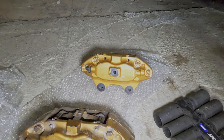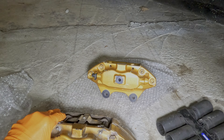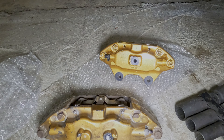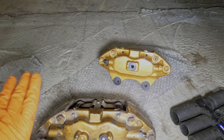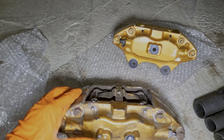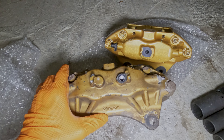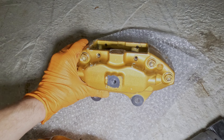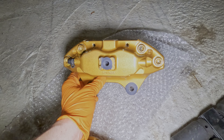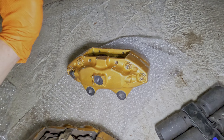So it's been a couple of days. I don't know who's a bigger bonehead — the guy on eBay that sent me the wrong caliper or myself for not noticing it. This is a lesson for everybody else: make sure you take a good look at the back of the calipers from any posting you're buying from. An actual STI caliper is going to have six-sided bolts mounting the casings together, a specific screw design, and the Brembo brand name cast into it. The ones I got have none of those things — as far as my research goes, these are for a Nissan Sentra Spec V. I have no clue how that happened, but I have to go through the process of returning them.